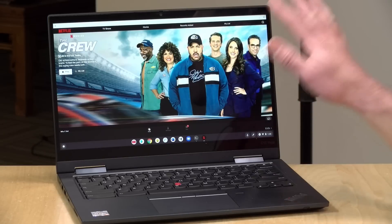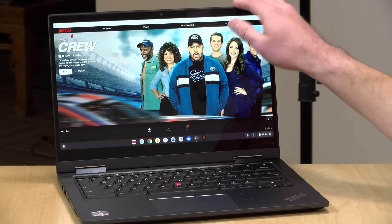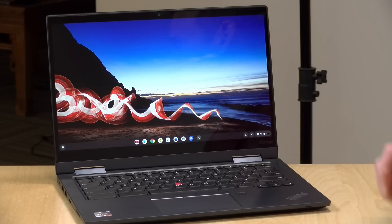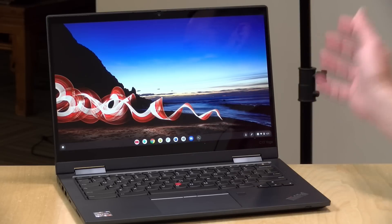I did notice that Netflix has issues with HD video on this machine, and we've seen this on a number of other Chromebooks as well. That's because the DRM level supported on this device is Widevine L3, which only allows for standard definition content. So movies aren't going to look so great on here from Netflix, but that's not a hardware problem — it's a software problem on the Google side. Hopefully future updates will improve the situation. We also ran the BrowserBench.org Speedometer test, and on version 2.0 we got a score of 88.5. From a browsing standpoint, this is going to be a great performer, but just be aware of the DRM issues related to video.